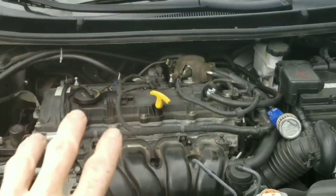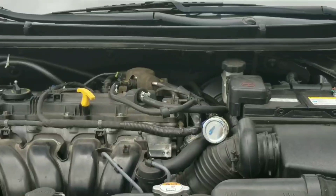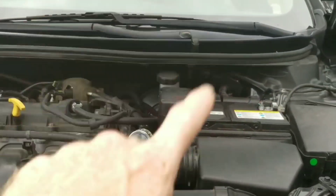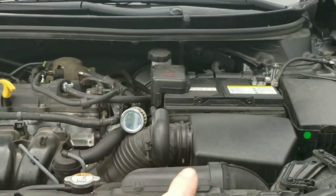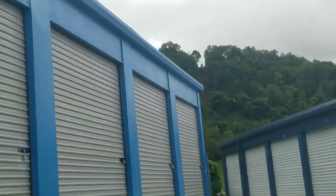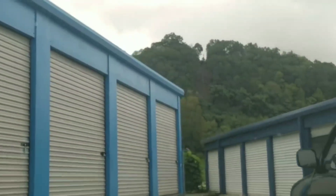Go ahead and let your engine heat soak for one hour. Next, go ahead and reassemble that air filter assembly. Once you've done this, move on to the very last step — and this last step: drive for 10 minutes. That's what we're doing now.